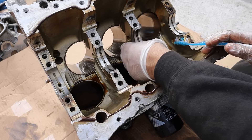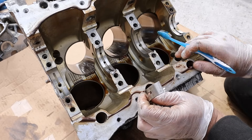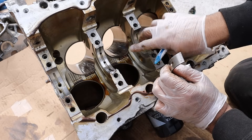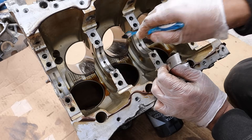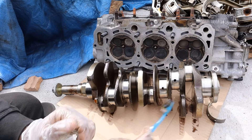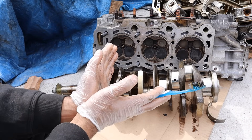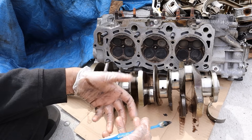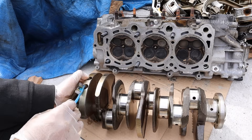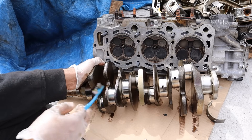The main bearings are looking pretty clean and in brand-new shape — this was a low-mileage engine. You've actually got six bolts — two main bolts and two on the sides — holding your main bearings down, which makes this engine nice and solid. There are also thrust bearings on either side so the crankshaft doesn't shift side to side. The aluminum alloy block has steel sleeves pushed in to form the cylinder walls — it's really this whole design that makes this engine so reliable. Looking at the crankshaft, we've got four main bearings, and between each pair of connecting rod bearings there's a counterweight. Any V-shaped engine has cylinders opposing each other so forces more or less cancel out; however, this being a V6, it's basically two three-cylinders next to each other, creating a natural planar imbalance. To counteract that, Toyota made the outside counterweights a lot bigger and heavier than the thinner inside weights — resulting in a very quiet, smooth, and refined engine, more so than the 3MZ 3.3L that replaced it.